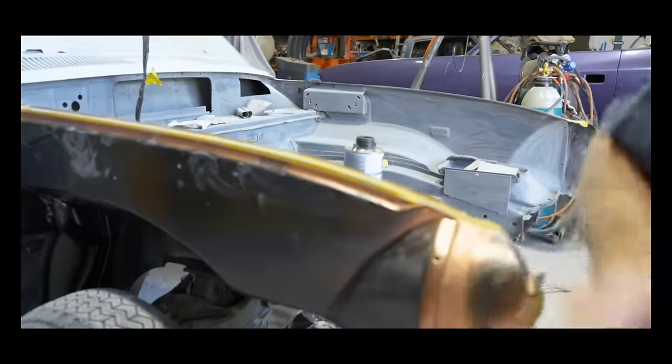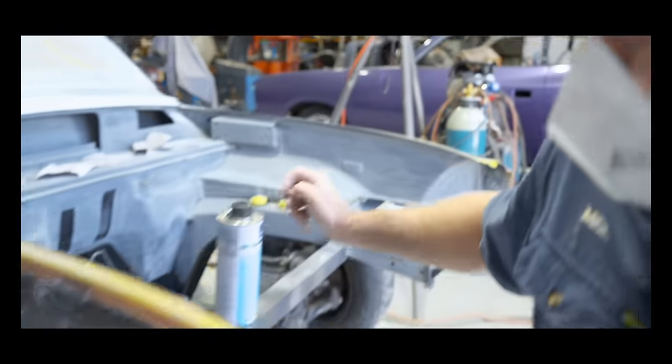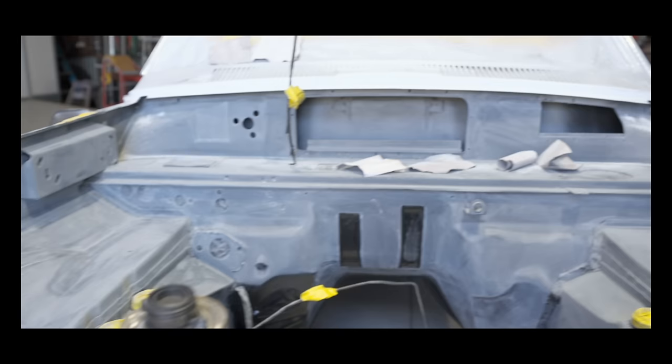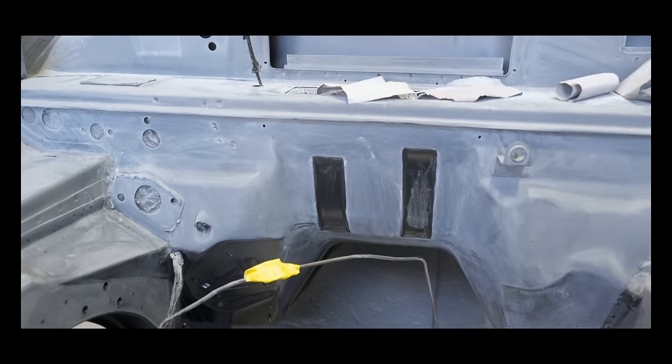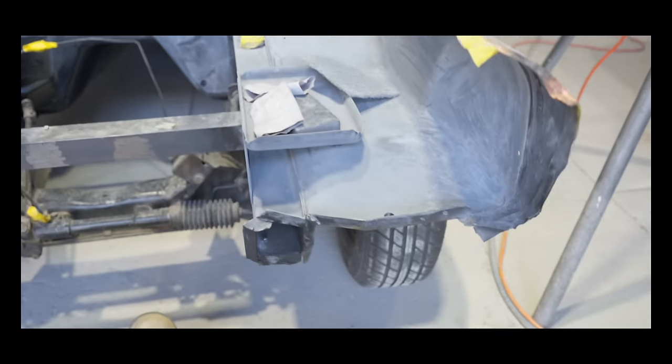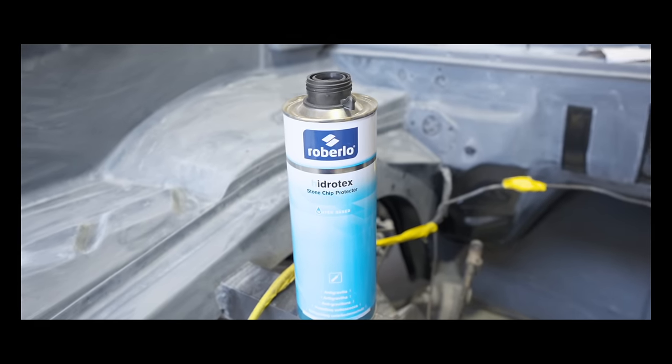I need to rub back the outer skirts, and then I can put some Hydrotex on there, Roberlo, that's a water-based stone chip protector. These areas inside the engine bay, I'm going to drop the K-frame out and I'll rub that later. But first we want to get the radiator support on and the guards and tacked all in place. I'll put that product in the description below.